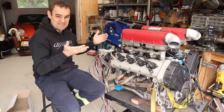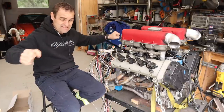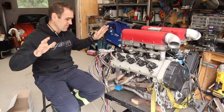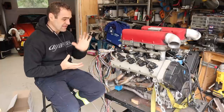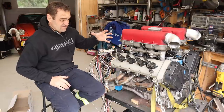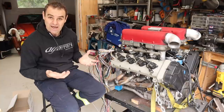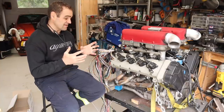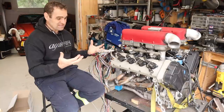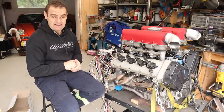They basically run this car as two four cylinders, so there's two looms, two ECUs that sort of piggyback off of each other. It's a bit of an old system that's not that great, and the Link is going to be a much better option. And like I mentioned last week, the engine is actually simpler than you would be led to believe. As I said, at least for wiring and basic components, it's much simpler than the Audi engine that I wired into my Rockstar.